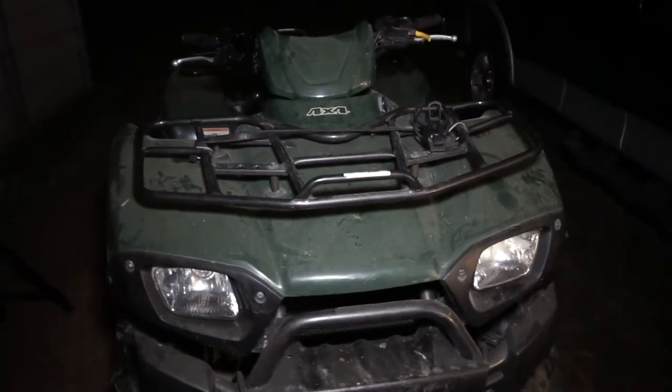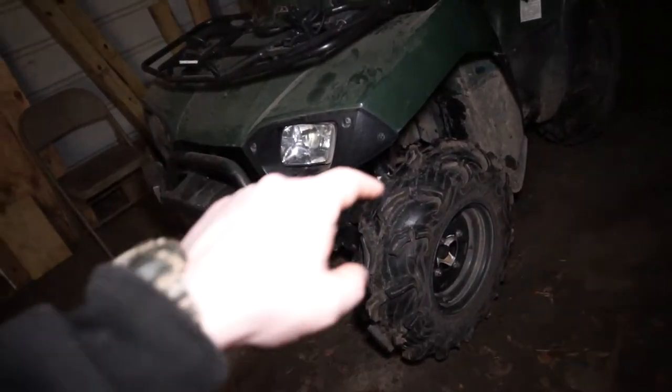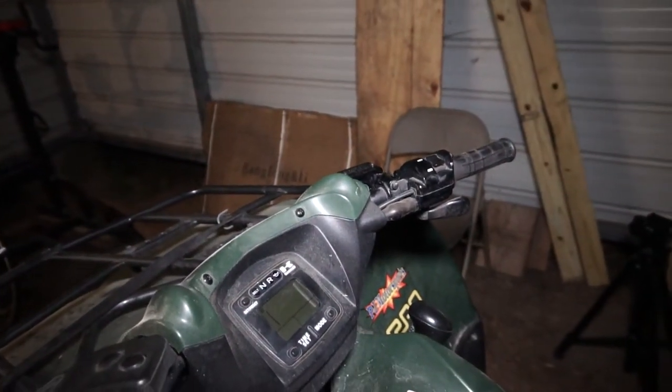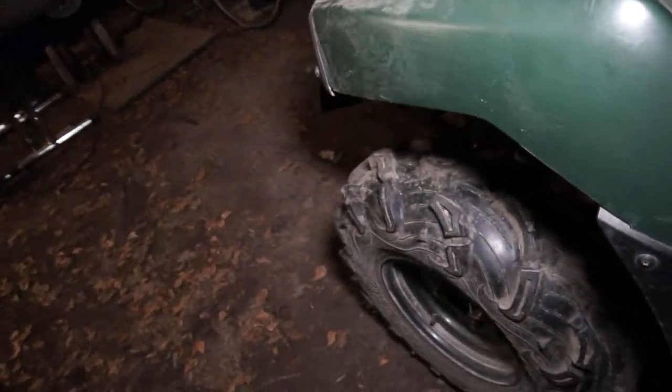It's all done — put back together, brakes are bled. It was very difficult to do this by yourself trying to crack the bleeder screw and squeeze the brake lever at the same time, so I did have a buddy help me. You probably want to do that. You can do it by yourself though — they make an automatic brake bleeder at AutoZone for about 40 bucks where you hook it up to the valve, pump it up, then crack the valve. Since I do brake jobs infrequently it's not a tool I have, so the easiest method is the old tried-and-true: have a buddy pump the brakes while you bleed it. That's going to do it for this video. Subscribe to my channel for more videos, mash that like button, drop a comment if you have any questions, and I'll see you on the next video.